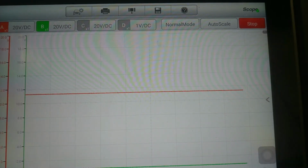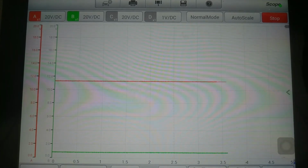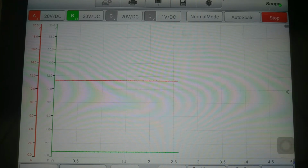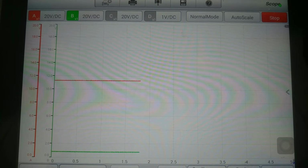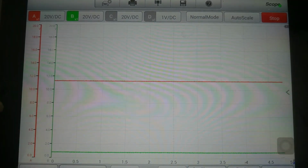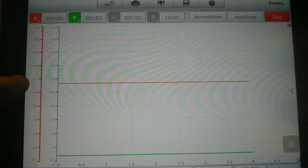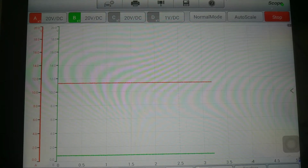Now, I was wrong in stating that this was a magneto-resistive sensor. This is an active Hall effect sensor, so the signal that we should be looking for is a square wave. Now, on Kia vehicles, what ends up happening is that the ABS module sends out a 12-volt voltage. Now that 12-volt voltage is on my channel A, which is this red one. And the 12-volt voltage is your power feed for your ABS sensor.